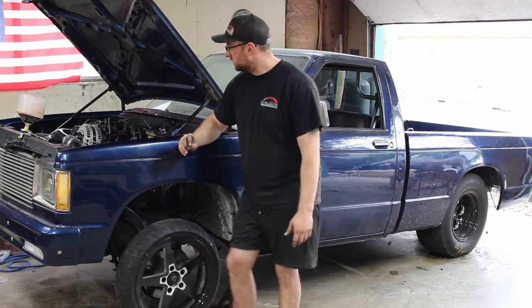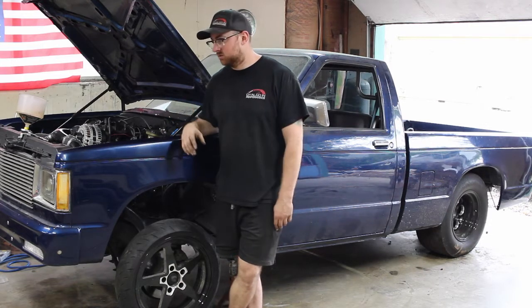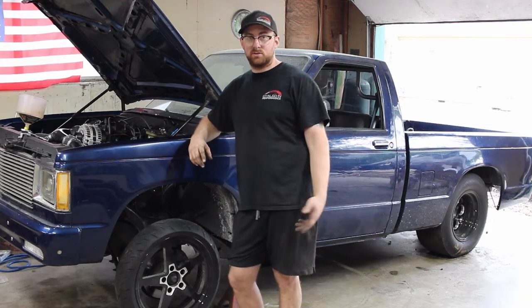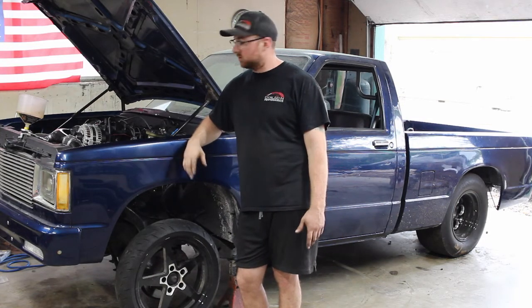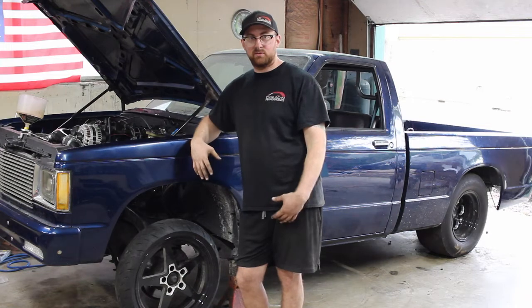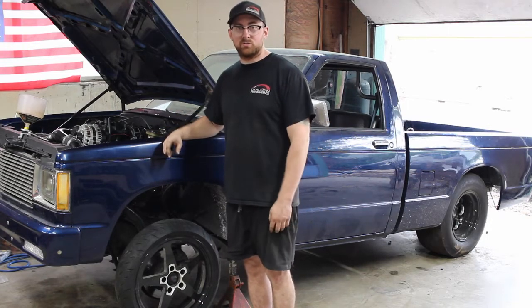The way we've been doing it is setting it up like a nitrous deal and using the nitrous tables. You just tell it what duty cycle to run and it'll run it — open loop. You can do that with a single three-port or four-port. On the more budget stuff, if you've got an eight-pound spring and only want to run 15 pounds of boost, that works fine.